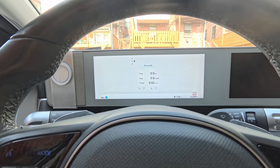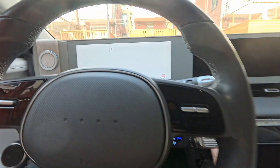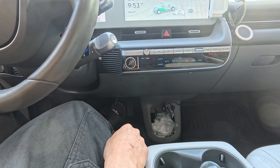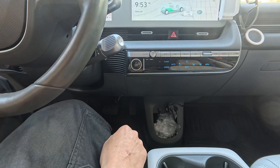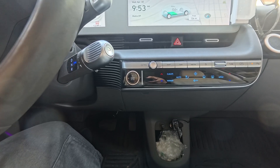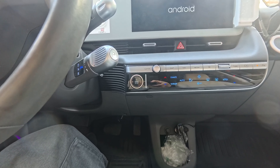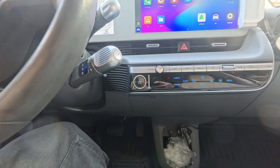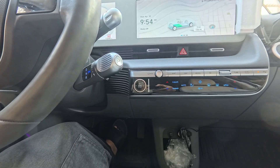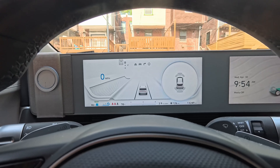Let's turn the car off again. Now, to start the car properly, go ahead and press the start button twice to turn it on. This time we're not pressing the brake whatsoever. The car is on — go ahead and input your sequence of buttons. Did you hear it? You can hear the emergency brake disengage, which means the car is now ready to drive. Go ahead and press on the brake and press on the start button. This time the car is fully ready to go — let's try to shift it out of park. Very good, we are now ready to drive.